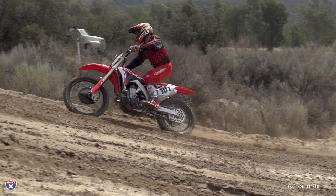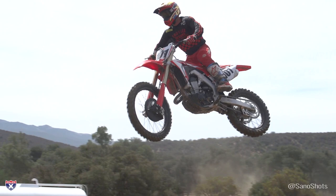The chassis on the 2019 CRF450R is a little tough for me to assess — it was a private ride day with not a huge number of bumps, just some chatter and chop here and there. We made a couple of changes: softened up low-speed compression on the shock, opened high-speed up a quarter turn, set sag at 107mm in the rear, and tightened rebound two clicks. The fork I softened two clicks as well and left the rebound alone. With those changes, the bike felt balanced. As far as the specific frame changes versus last year, I'll need more time to really break that down — we will do a dialed-in video for that.